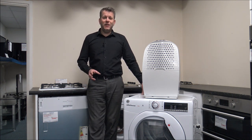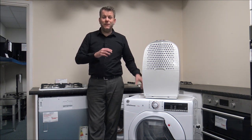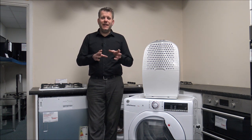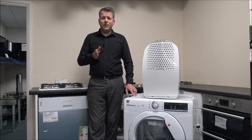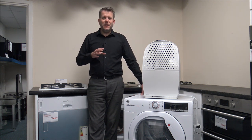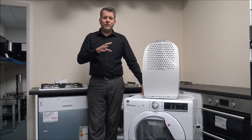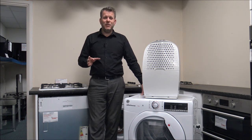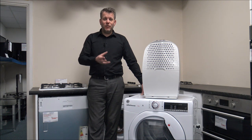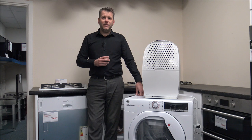Number seven: another tip on reducing drying time is to look at the spin settings on your washing machine. Some people use standard programs, and if it's a 1400 spin machine, some programs you select might run at a lower spin speed. Always check that. If you've got a high spin speed machine, make sure it is running at the maximum spin. Also, when you've finished the program, put it on an extra spin. Sometimes the program won't spin at the highest speed for very long — it gets up to 1400 RPM but reduces quickly. An extra spin at the end doesn't cost a huge amount since there's no heating involved, but it can extract a lot more water out of the clothes, making the whole drying process quicker and more efficient.